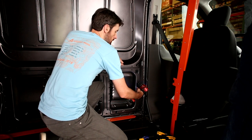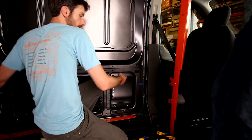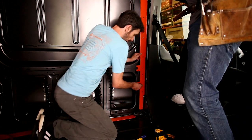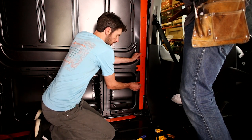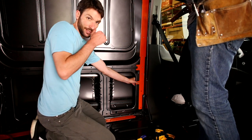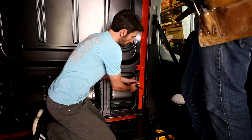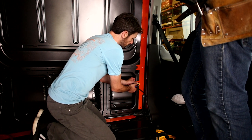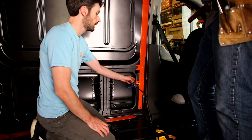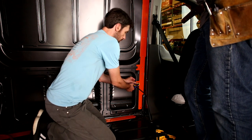After cleaning it up and putting rust proofing in there, this will set the height of the piece. The slotted index hole goes into that hole and then we know we're good. This part of the build is where an extra set of hands is really handy, and at the very least some clamps to keep stuff in place. Clamp halfway onto the rivnut to keep it in place without actually clamping onto the backside of the rivnut — it's one of those things you have to get hands-on with to understand. That's setting the height so we can set the horizontal piece as well.